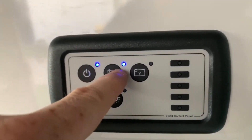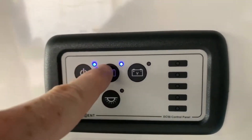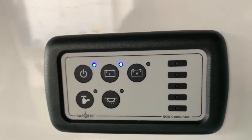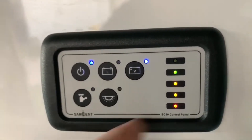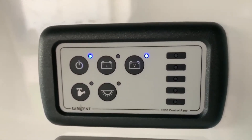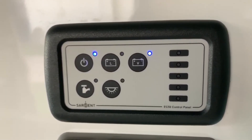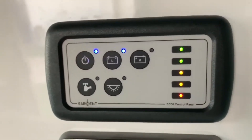The selected battery is indicated by the LED illuminating, so as you can see we have the leisure battery selected. I can check the selected battery voltage by just pressing it again — you can see there we have a nice strong voltage because of course this is on charge. We can switch batteries by pressing the required battery button. Here we have now switched to the vehicle battery and the voltage is indicated there. Please bear in mind that by selecting the battery you could be draining it, so if you're not plugged into mains electric charge, only temporarily view your vehicle battery voltage before switching back to the leisure battery.